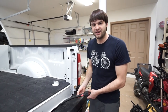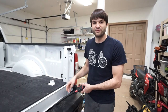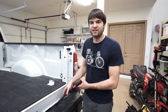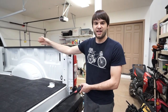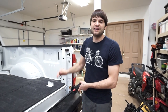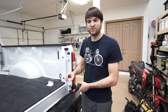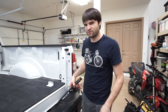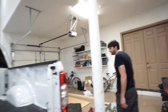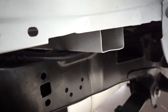You'll notice the bundle of wire — we wrapped the entire length of it in some shielding. That just helps it avoid being rubbed on stuff and creating sparks. One of the things you want to pay attention to is how you run this cable. In our case, the battery is on the passenger side, so we ran it straight down from the battery on top of the frame and then to the back. Anywhere there was a possibility of rubbing, we wrapped the entire two cables with some large rubber hose — just cut down the center and zip-tied it on. That gives a little extra insulation. The wiring is tucked up as high as possible along the truck.